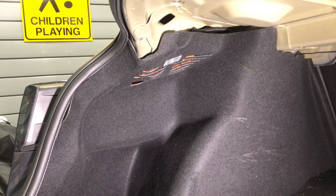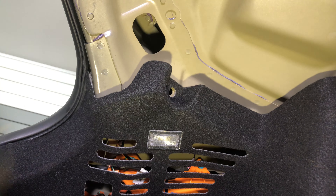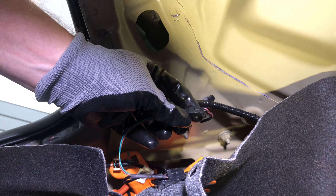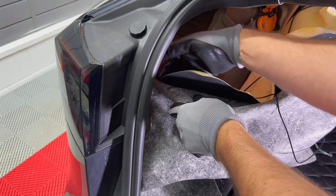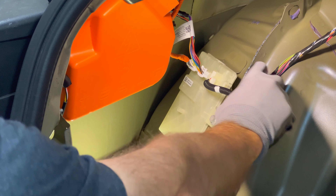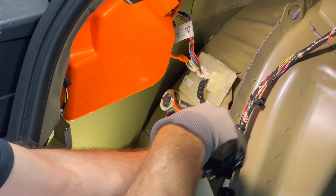In the trunk, the ECU is located on the left side behind the fabric trim piece. Find the trim clips — you may have more than one. Use the plastic pry bar to pop out the trim clip. It may be easier to unplug the LED light connected to the panel. Pull back the fabric trim; it's soft and can be bent out of the way. Looking in the area behind the trim, you will see the existing charging ECU attached to the frame of the car. It has one 10mm bolt — unscrew it with the socket wrench and place the bolt aside.